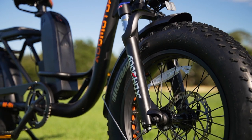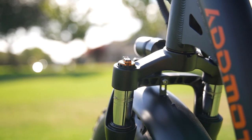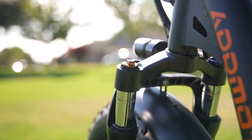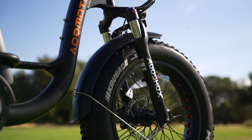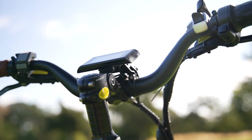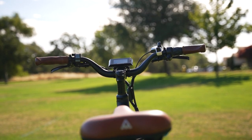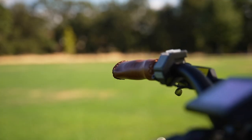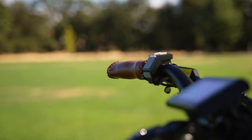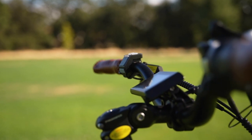At the front, we've got AdMotor branded spring suspension with around 100mm of travel. These forks also have preload adjust and lockout, so you can fine-tune them a little bit. Your riding posture can be fine-tuned too by adjusting the angle of the handlebars — set them low for an aggressive riding posture that gets more power out of your pedal stroke, or raise them up for an upright and relaxed posture, nice for just cruising around.